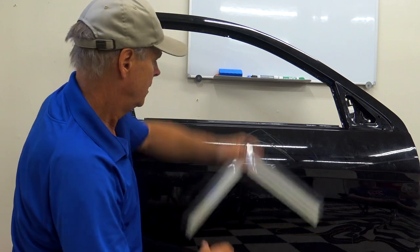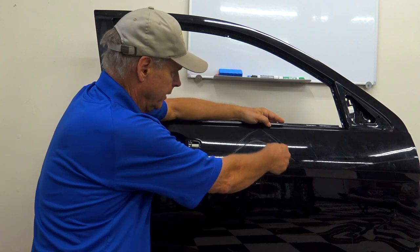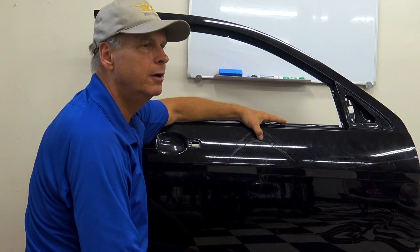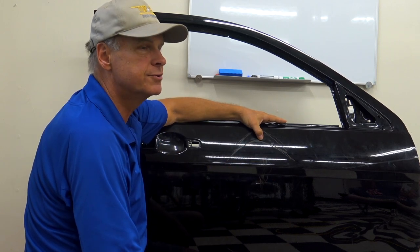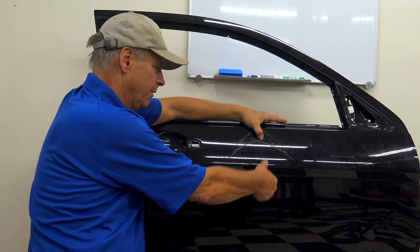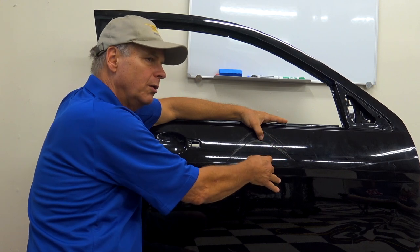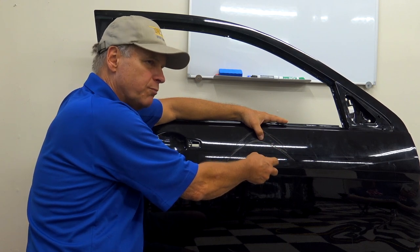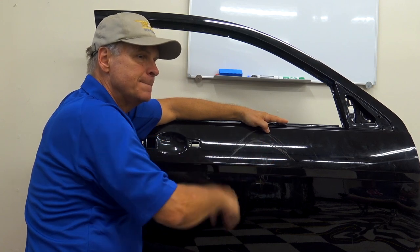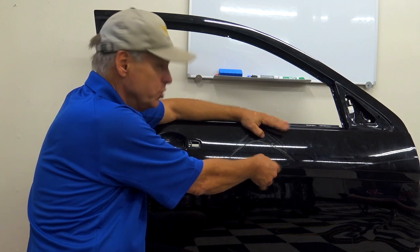So, enough energy made it past the body line and formed us a nice little crown. What do we do? Still the crown. It's always the crown. But it was hit there, and the energy went past it, and I still feel that crown should move. Well, we'll accommodate that. We'll put some pressure on, 100, 120, 150 pounds. But why am I doing it? I want the crown to move. Crown is king.